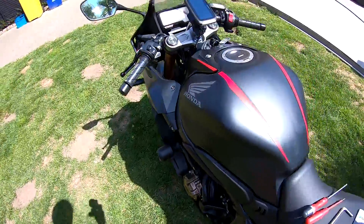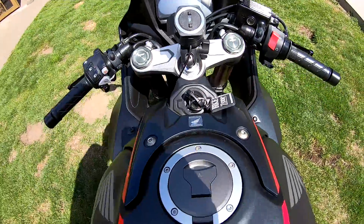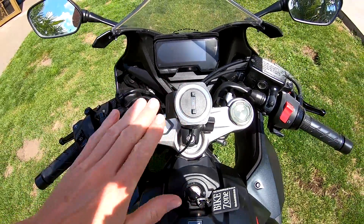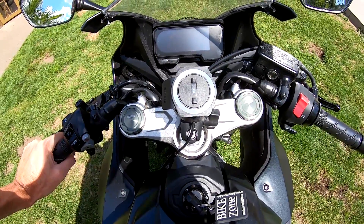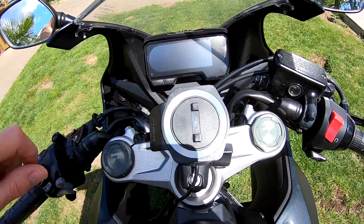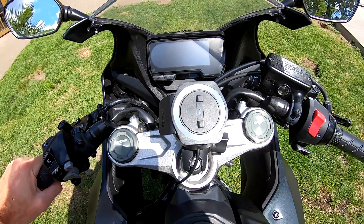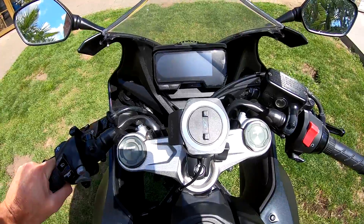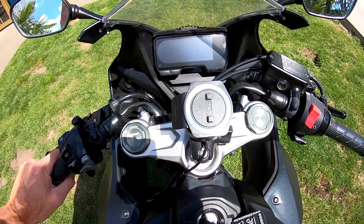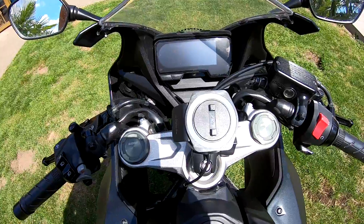We will install it on the bike. In my previous bike I put the wires straight to the battery, and on the positive side I placed the fuse. But when the bike was outside and it was raining, if you have water between the two pins, you have 12V on it and you shortcut your battery. You can see a little bit of white over here — that's from the electricity. So now I'm going to place the wires only when we make contact, when we switch from 0 to 1, so that it is possible to charge the TomTom. And if you connect it directly to the battery and leave the TomTom on it, it can drain your battery.